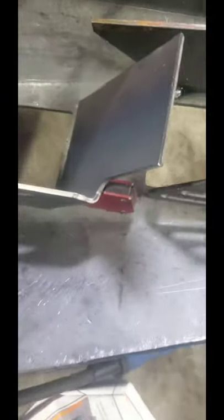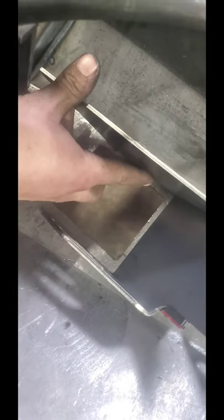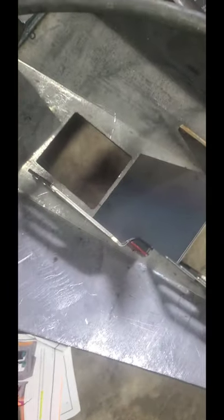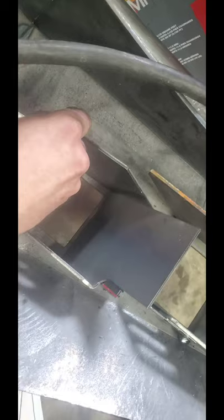I've got some magnetic triangles to hold the angle right on this piece and space it away from everything. I've got a little more adjustment to do, then use your square to keep the trim piece perpendicular to that and perpendicular to the bumper itself, then weld it in. If I were to mount them like the instructions say, the angles don't really match going that way, so I'm doing it my way.